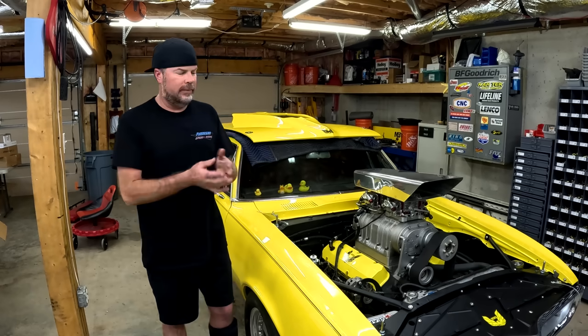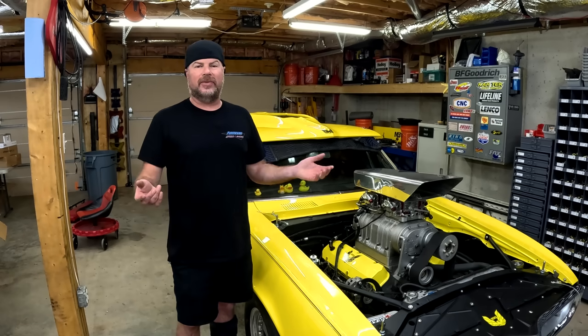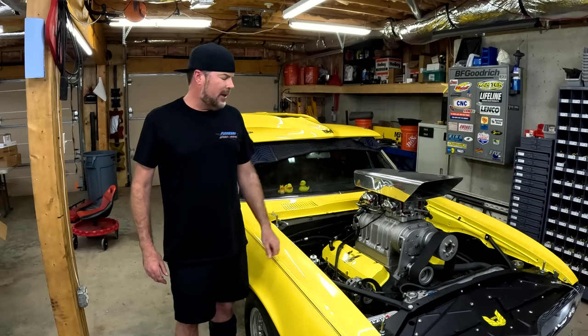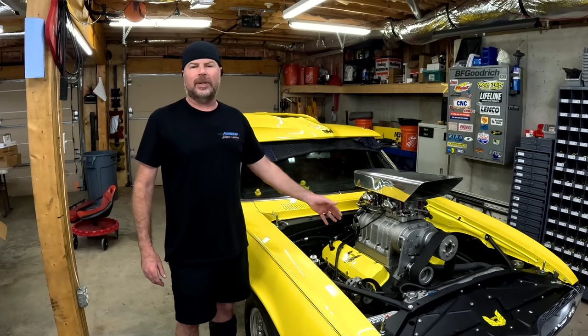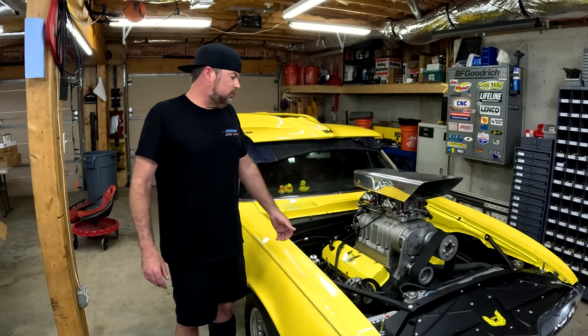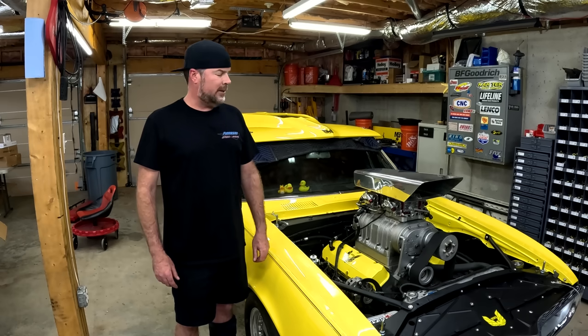Good news! No broken springs, no excessive valve lash. We did tighten up every rocker arm just a couple thousandths because I think it might be happier at 22/1000ths lash than it was at 25. Time to go back to the track. We're gonna load it up and head out to Alabama.